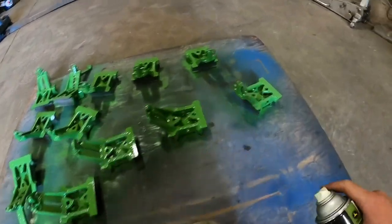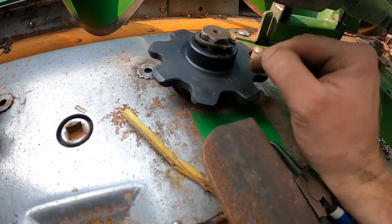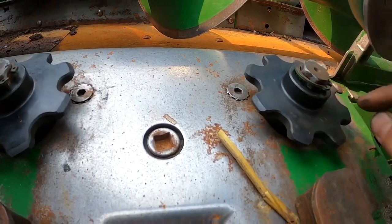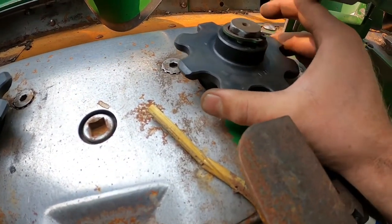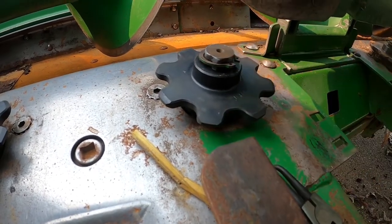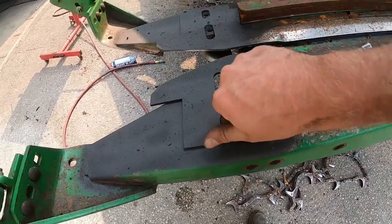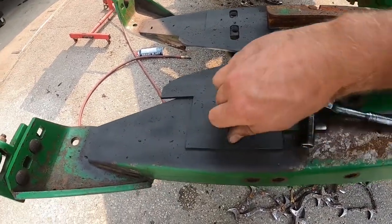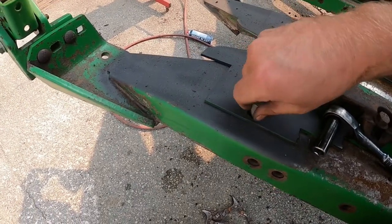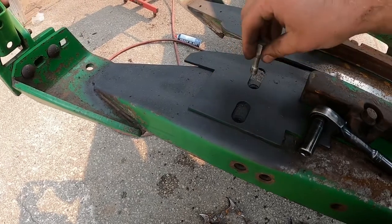When you buy new parts you're pretty much just paying for paint anyway. When we put the new sprockets on, we put a little bit of anti-seize on there, because everybody knows they like to get a little bit of junk and corrosion in there and they'll be sticky when you take them off next. So that'll just help it come off next time. Now we've got a chaser — just gonna take that through all the holes to make sure the threads are pretty clean while we clean up the bolts.